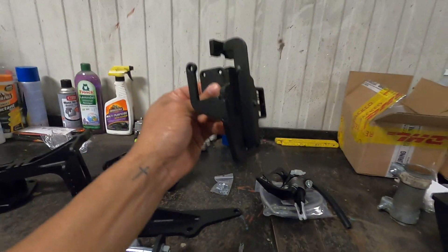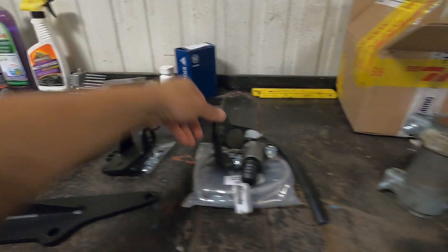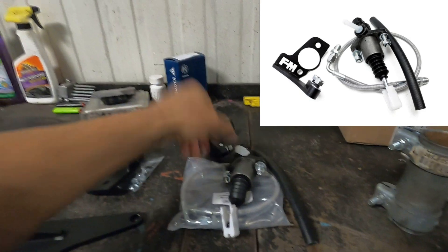Over to this piece — this is the Mark 7 gas pedal adapter, the exact same one I put on the Savoy. With the 1.8T, the car is drive-by-wire versus having the cable throttle body, so we swap to the Mark 7 gas pedal which has the correct connector on it.